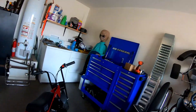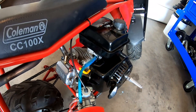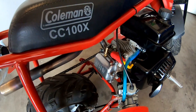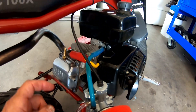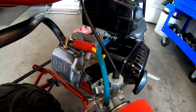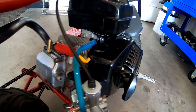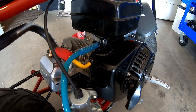I'm going to do a back-to-back-to-back head comparison with the Coleman CC100X minibike with the Predator 212 Hemi on there. I'm going to use this bike because I can get really consistent from 0 to 30 and the front end is easy to keep on the ground. This Predator Hemi has a totally stock head - the only thing done is 22-pound valve springs, and internally it has a mod 2 cam, billet rod, and billet flywheel. Just a basic build.